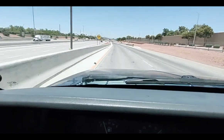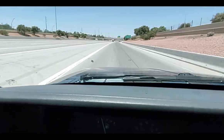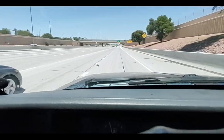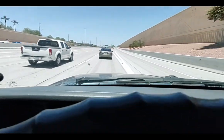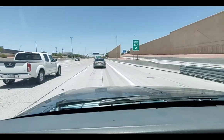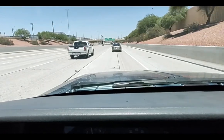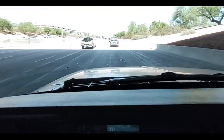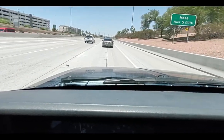At fairly full throttle there's no vibration at all. Coming up over 65, 70 — smooth. At 75 miles an hour there's just the tiniest bit of vibration, but I'm happy. When I started, by 45 mph the thing was bucking and shaking really badly. With the original shims it came on around 65 and got progressively worse. Now it's great — it's a Jeep, I'm happy.